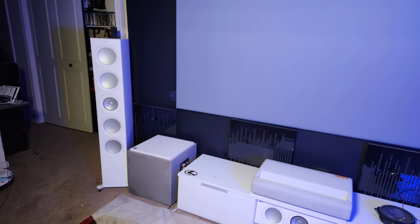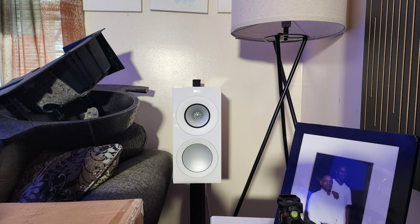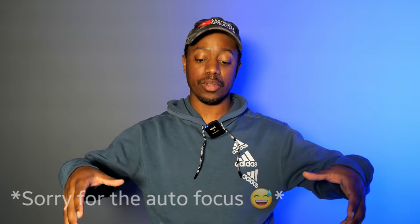Let's talk about how to set up a 7.1. We start with the five: front left, center speaker, front right, rear left, and rear right. As discussed in the 5.1 video, the rear speakers don't actually go behind you — they go on the sides of your seating position. The 7.1 channel system adds two more speakers to your bed layer: your surround back speakers, which now position behind you to add an extra bit of immersion to your movies and Atmos music listening.